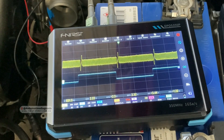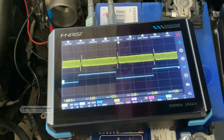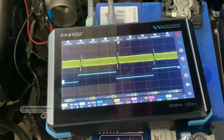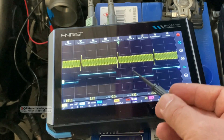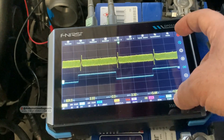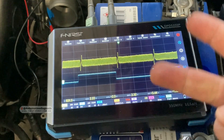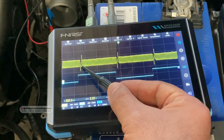The first thing we want when reading a waveform from any oscilloscope is to make sure the waveform actually exists. We have the waveforms right here, and we don't want any sort of abnormality on them. We have a nice square waveform on the cam sensor, and this is the waveform from the crank sensor. If the oscilloscope is capable of showing one full cycle — meaning two full turns of the crankshaft — that's going to be really good. This is the signature waveform showing us the top dead center.